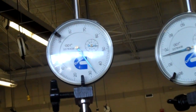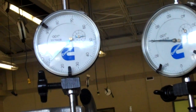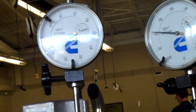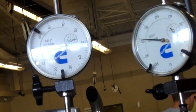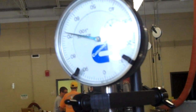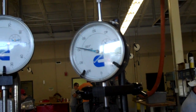Now we're between three and two, so we need the number three on the big dial — reading one, four, three. The reading for the injector push tube dial is .372.